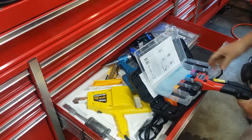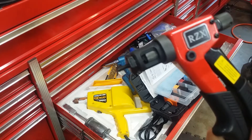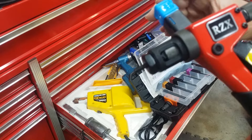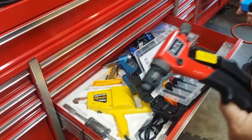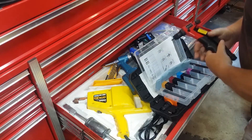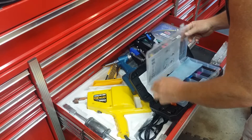This smaller tool does a variety of smaller sizes and comes with a bunch of dies. For example, this is the quarter-20 die for this tool. It currently has a 10-24 in it. It goes pretty small and even metric sizes up to quarter-20 — quarter-20 might be a little bit hard to pull with this one. I made this case for it — well, I bought the case and modified it to fit — so it fits nicely in my toolbox.